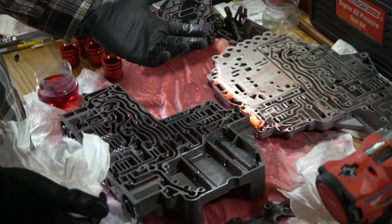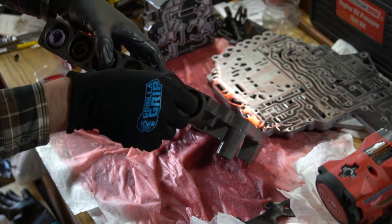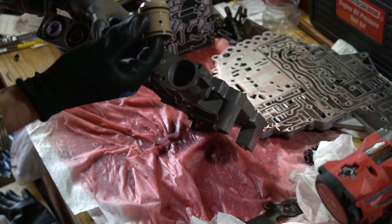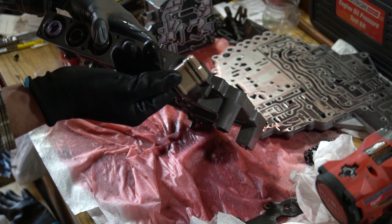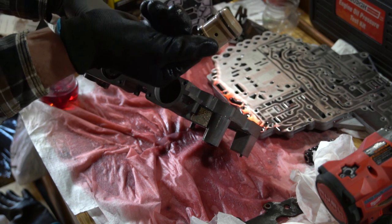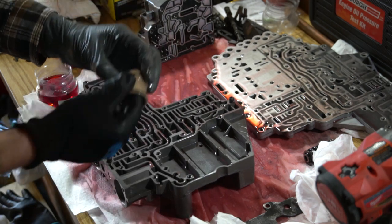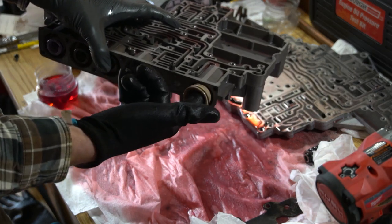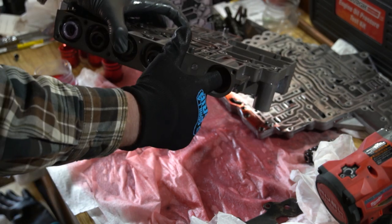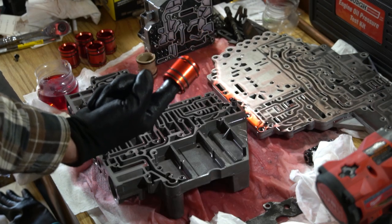Go ahead and get yourself a big box of shop rags because trust me, you're going to use a lot of them. So I'm going to pull this first set of springs out and pull this piston right out — and I can way too easily. This thing is definitely not creating a seal, that's for sure. The two seals on it appear to be a scarf cut style seal, and let's just say they're not sealing anything. You can see how easily this thing slides in and out of there — the tolerance is way too loose. That should not come out that easily and I think we're about to find out that these new billet accumulator pistons will not go in there without a fight.